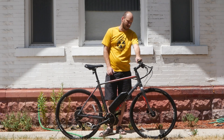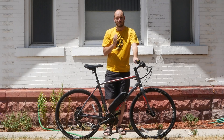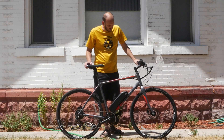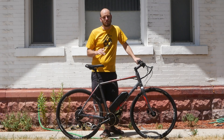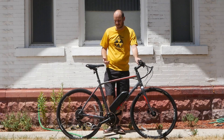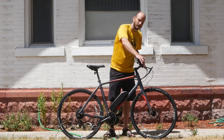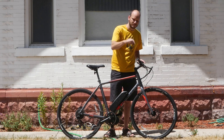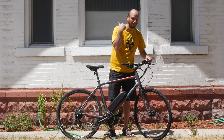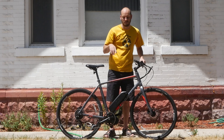This thing flies. It's got tiny tires — 700 by 32C — so these cut through the pavement really well, really fast. It's got hydraulic disc brakes, the Tektros. That's what kind of makes it more of an intermediate bike. For those we put hydraulic brake cutoffs on it — they're little magnet pickups that sense when the lever is pulled and those magnets get separated. It says they're braking, let's cut power. So you can't accidentally hit the throttle or pedal — it cuts power.